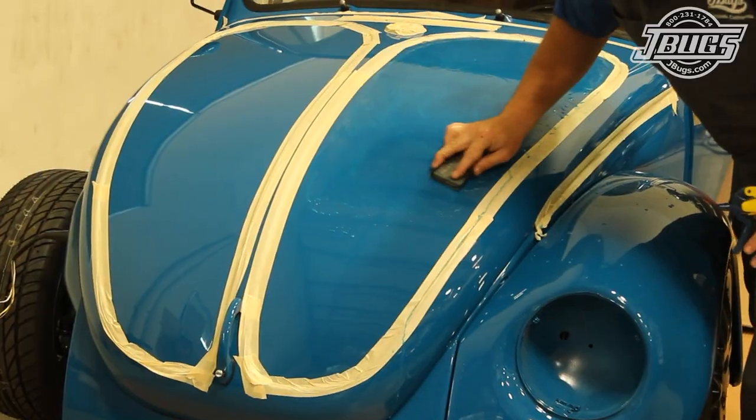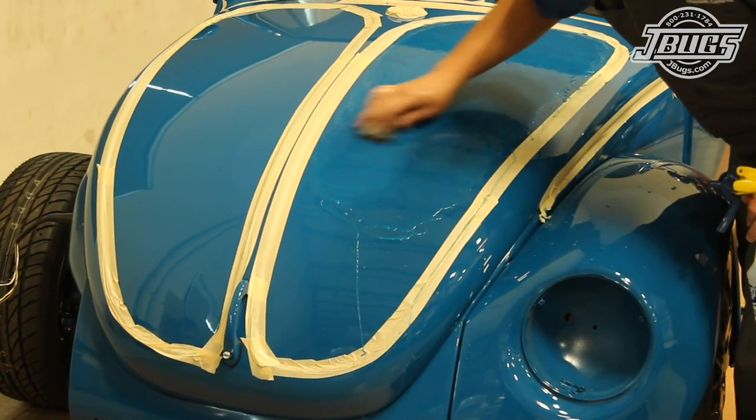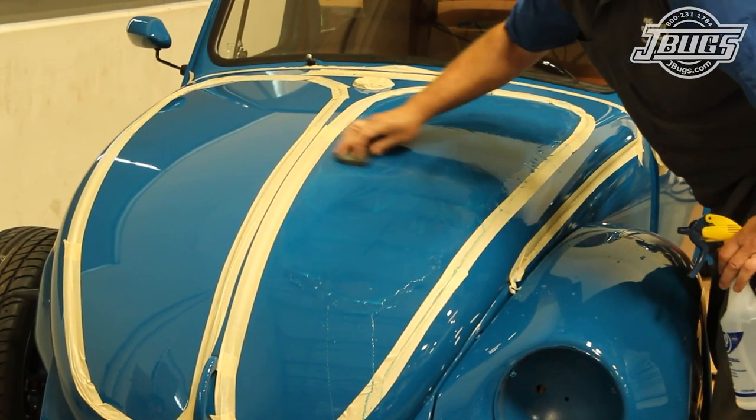To take care of these problems, we're going to sand the paint down smooth. This might seem crazy, but with very fine sandpaper we can smooth the paint down, then polish it back to a shine. Wet sanding and detailing experts might start out with paper or file blocks as rough as 600 grit and eventually finish with 3000 grit. Myself and the guys I've worked with find that starting with 1000 grit and finishing with 1500 or 2000 grit sandpaper will do the job just fine.